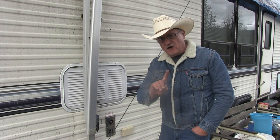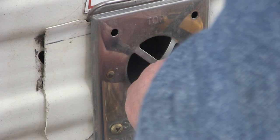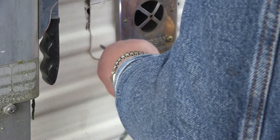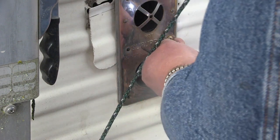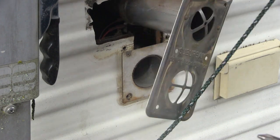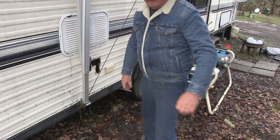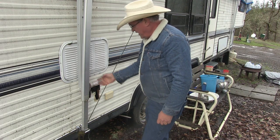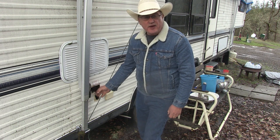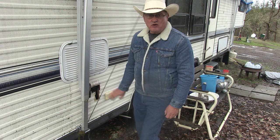The disconnections we're going to make from the outside first, before we go inside, is we have to remove these four mounting screws and this screw right here in the middle. Then you have this piece that just should pull right on out of there. You'll notice that the hole has been modified because the furnace that was in here when I bought the coach, it mounted crossways. I purchased a brand new furnace, put it in here, and it had the intake and output going laterally instead of horizontally, but it fit the space.